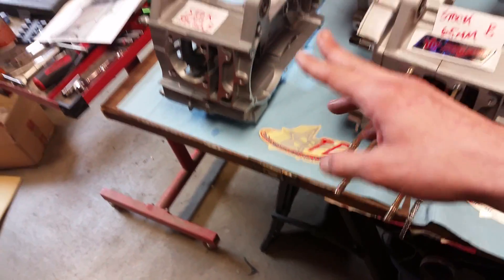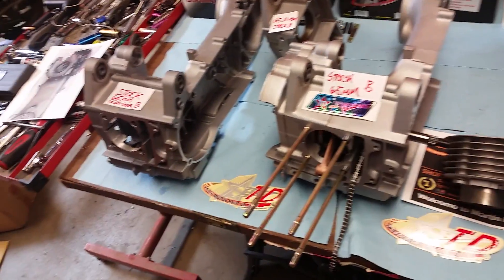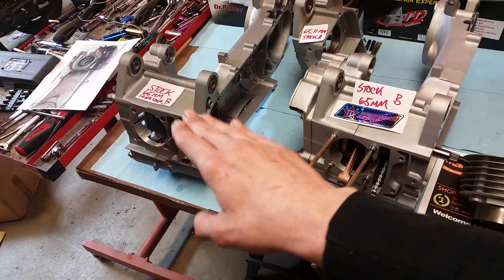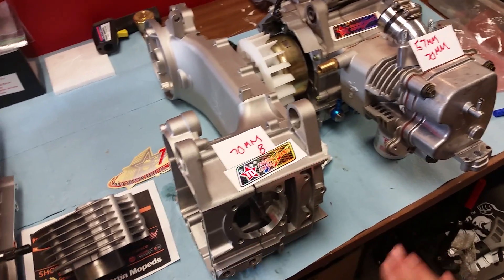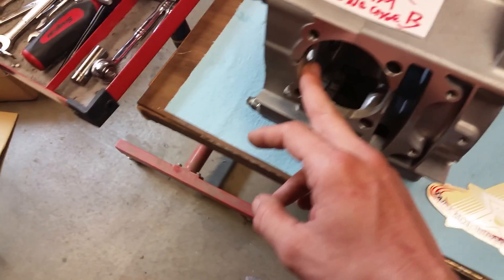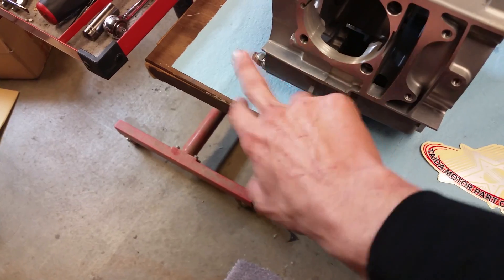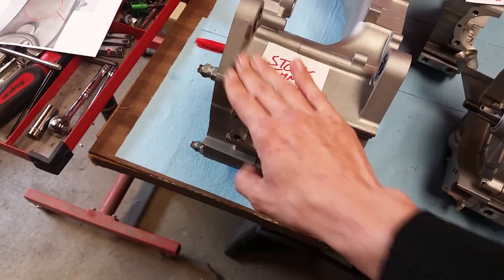The other ones you'll find — the 180 power kits or the GY6 200s — maximum you can go is 180cc, whereas with Tata you can go to 232cc. That's why I'm sticking with Tata — completely superior. This one right here I cut open too much — I was seeing how far I could go. I have this open to 68 millimeters and look how far I'm into that oil port. I'll need a different side of the crankcase, but this block isn't a total loss, just this one side.